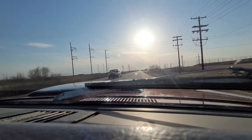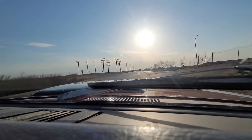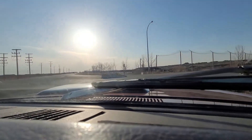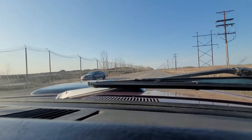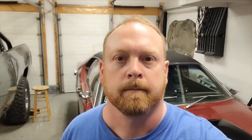That could be a combination of things — it could be running out of fuel up there, or I know I should have more valve spring in this thing. The easy test is to throw a couple more jet sizes at it and see where that brings me. But at least I'm 100% confident I'm going in the right direction. Before, at about 4500 RPM it would stumble and fart and completely lose power. Now it's revving clean to 5000.